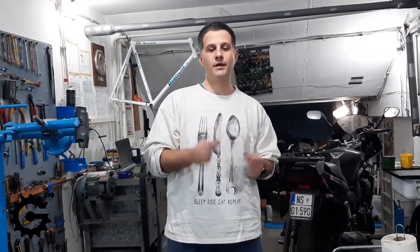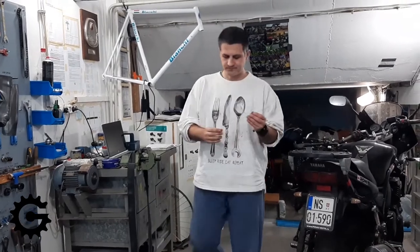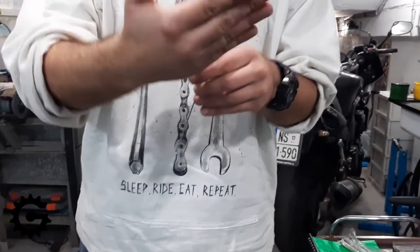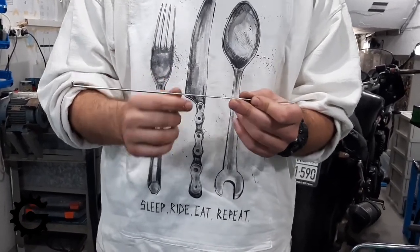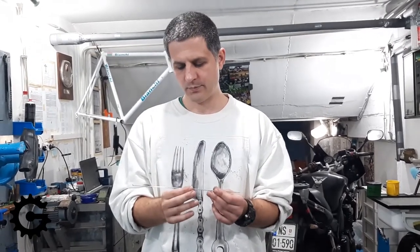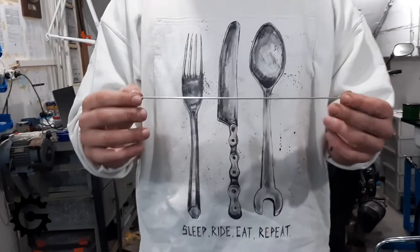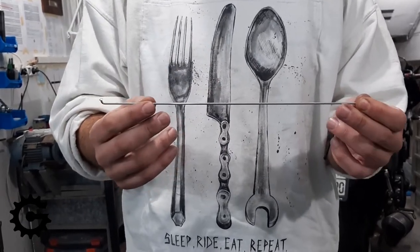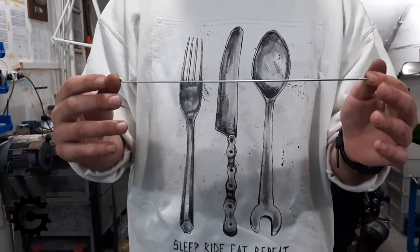There is only an optimal choice when it comes to spokes. In my opinion, the optimal spokes are 2mm thick and preferably thinned down to 1.8mm in the midsection only. The weak parts that have more stress are the elbow and the nipple end — spokes very rarely break in the midsection. When you thin the midsection, you can imagine it becoming like a shock absorber: any extra strain gets taken out by the midsection, which is otherwise not under great stress, so it elongates a bit more without putting extra load on the end sections.